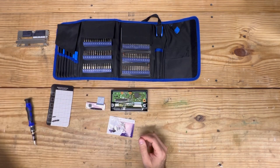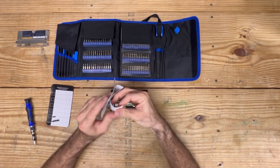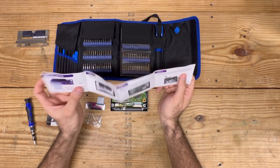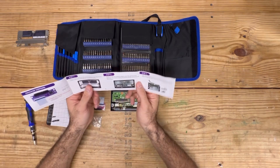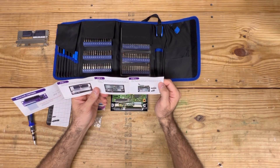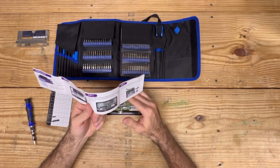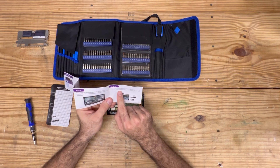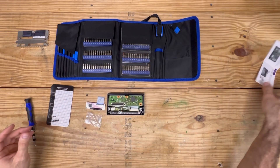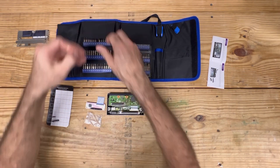Looks like it did come with a set of instructions — let's just go through it for the sake of the video. It includes two Phillips screws, two spacers. It is suggesting we remove the metal plate, which we have already done. And below is what we're working with here. We're going to remove these four Torx screws because PlayStation decided to go from Phillips to Torx — I believe that's a T7. And then after that we'll remove the IDE circuit board.